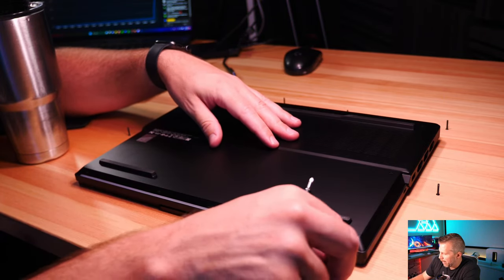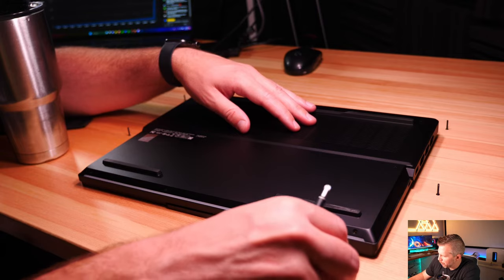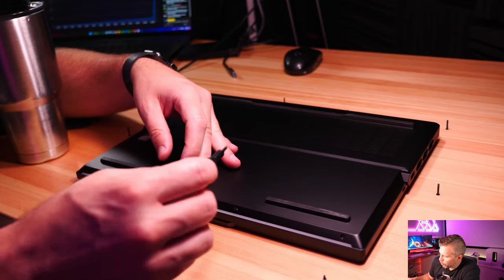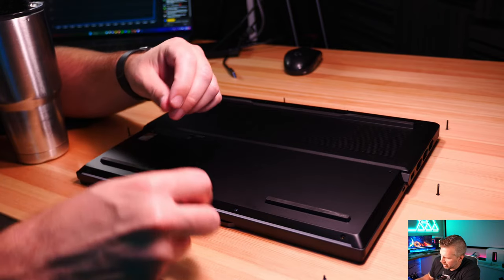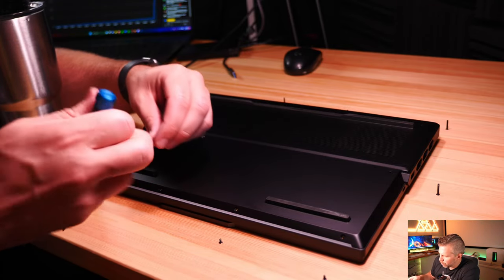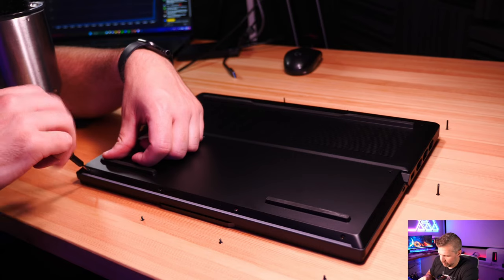So I hope we don't run into that issue today. We might. We'll have to keep an eye out for it. You know, we're gonna be plugged in and we're gonna be running in performance mode. I don't think we're doing custom mode, but if you are running into that power adapter draining the battery issue, then the key is to honestly just try to reduce the power usage of either your GPU or your CPU by like 5 to 10, 15 watts and see if that fixes it.